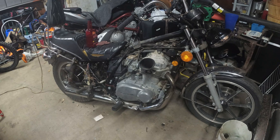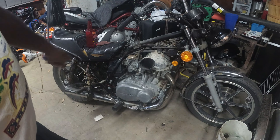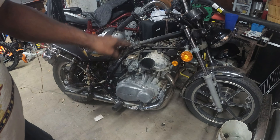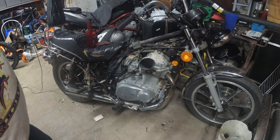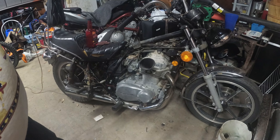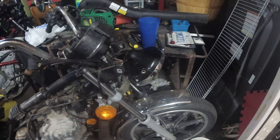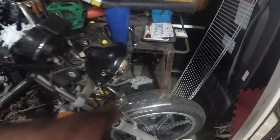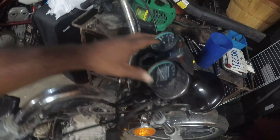I think the battery stopped on me, so I'm gonna charge it up. I still got that airbox off, pulled the battery and got the other battery I have for this — same battery since I've had a few Kawasakis. I'm gonna get the Mystery Oil in there, then try to get it up on the center stand so I can move the back wheel. Once on the center stand I can rock that back wheel and see if I can unlock the motor — if it's weather-seized it won't turn, if it ain't it should.